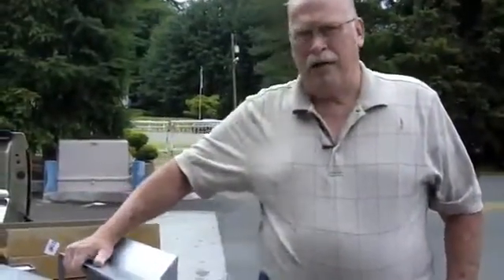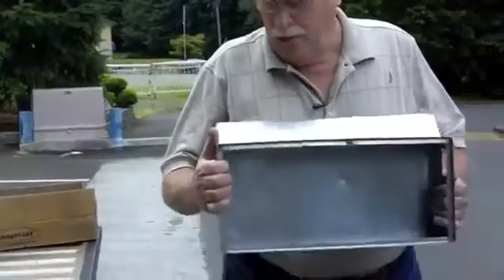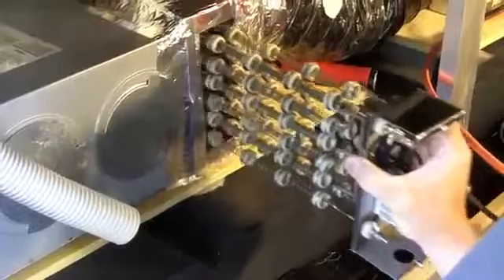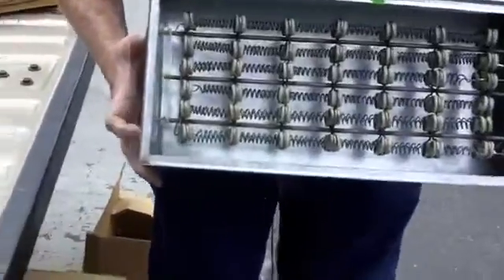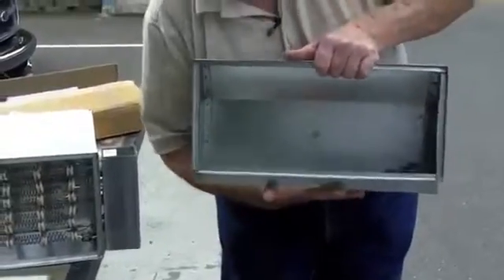What we've been talking about is the controller and the heater element. The last important piece is the add-on cabinet, which fits on the end of the furnace cabinet inside the coach. The air from the furnace blows into this cabinet, which houses the coil that slides inside. It can slide in from either side, and there's a plate that fits on the opposite side with locking pins to support the heater element when traveling. One cabinet design is for the ducted system with individual ducts, and the other is for the plenum system where the duct runs underneath and attaches directly to the furnace.